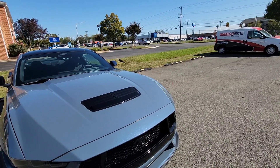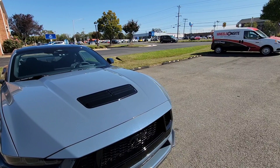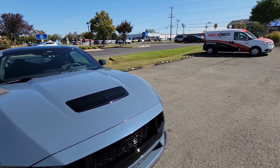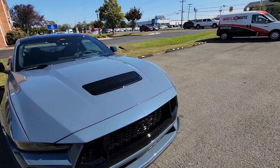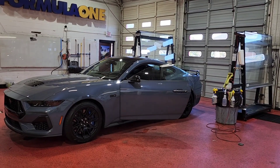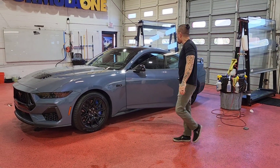Do you want it darker on the back? I think if you want it a little dark on the back it'd be cool, and 30 on the two fronts maybe. I'm thinking 15 on the rear. You think 15 on the rear window, or the small quarter windows? Well, if you want the sides to be the same, you can do 30 down those. The small quarter windows don't really matter. The back window, we can darken it up and do a nice 15% — it'll look like a factory truck.